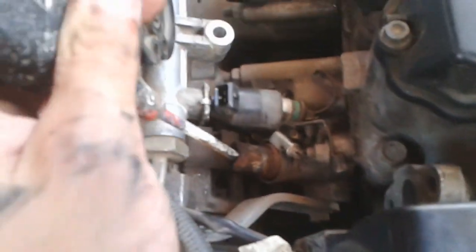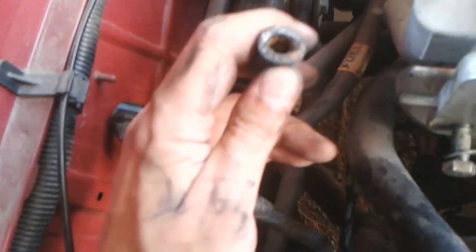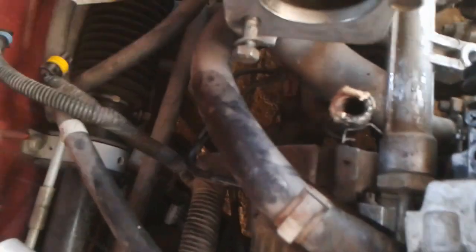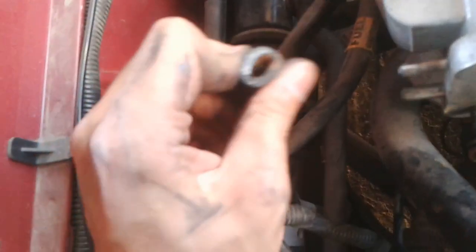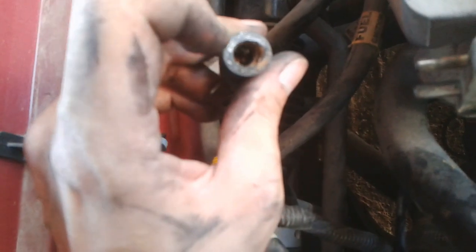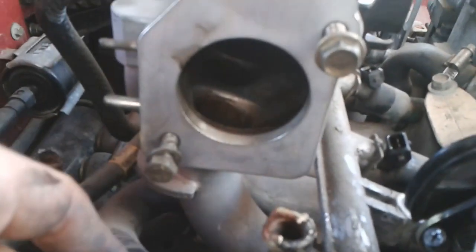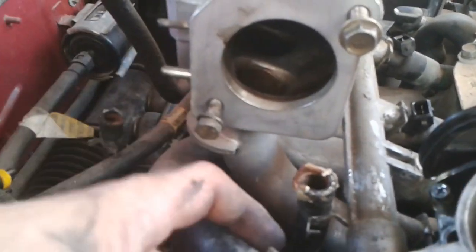You can see the debris flying out. There are more major blockages and rotten hose outlets on the throttle body. This thing goes up here - there's a turning wire or something and it's completely blocked. I doubt there was any fluid flowing through this thing. However, the intake manifold looks good inside - it was cleaned about five years ago and still looks good.